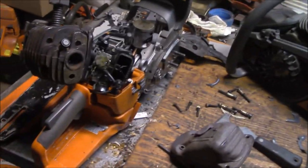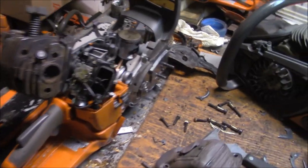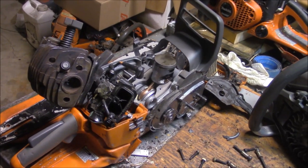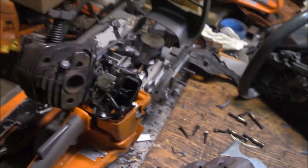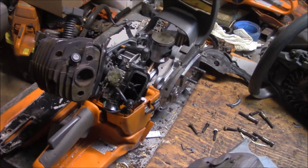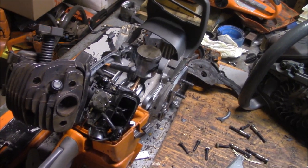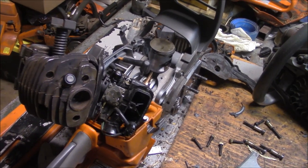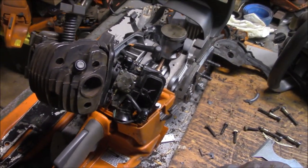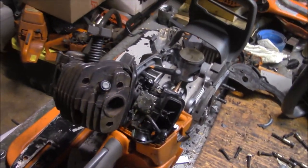I also look at it as a little more pulse for the carburetor - it's just a lot of stuff that happens. A person who wants to port these things has to take that into account - maybe open up a little bit or blend the radii to make things flow better. But I don't think you're going to find some quantum leap in how much gas-air mix you're going to get through that saw. And then in my mind, the 800-pound gorilla with these autotunes is how much fuel you can get through that carburetor - there's only so much it's going to be able to deliver, and that ultimately determines how much horsepower can be made with that setup.